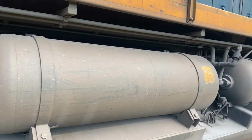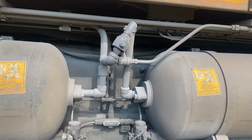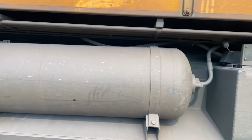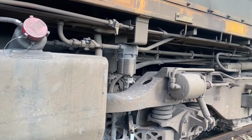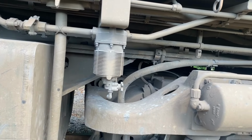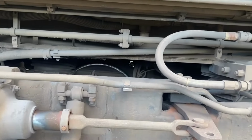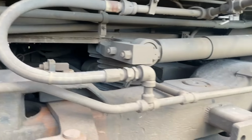These are auxiliary air tanks. And there is the piping for that. When you hear the train coming down the track and it goes psssh, that's what that is. It's spitting the air out of the air tanks. If I'm not mistaken, that's what that is there. And it has the reverse valves on it, so while the locomotive's running, it won't spit on the employees as they come by. A little bit closer look at the trucks.